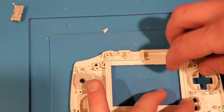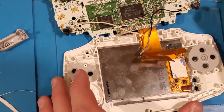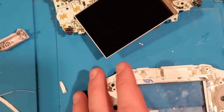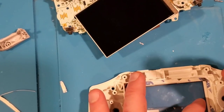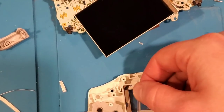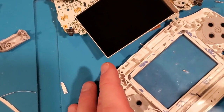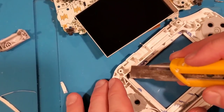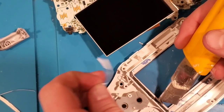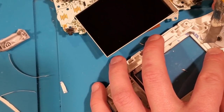So this is the end result — I've removed that length of plastic right here. We've left this slightly angled bit so that when you put the left trigger in there, the spring-loaded bit has something to press against, and that's still going to work. Now let's throw those spacers back in and double-check that this is actually going to fit. I did make a mistake here — when installing the spacers I put the vertical one on the wrong side, pushing the screen further in the direction I didn't want. So this actually needs to go on the other side.